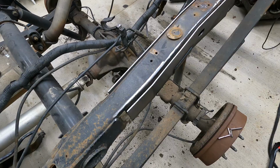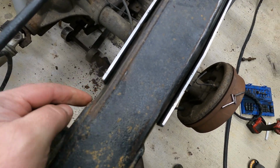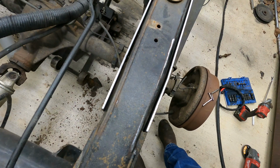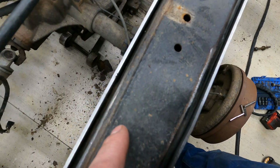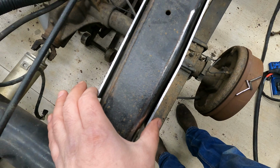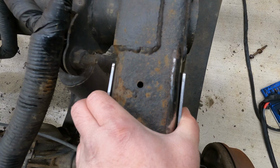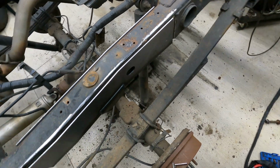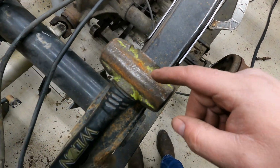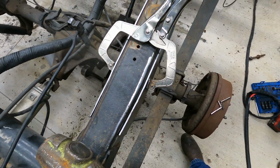Welded in. The frame cap is in place, and as you guys can tell, the fitment isn't as good as the other side. But that is because, as you guys can remember, I welded a plate in last time, about a year and a half ago, and that's why it's got this gap. You can see, maybe, the plate ends about right here. Now I'll end up squeezing this together, all the way down through here. It ain't gonna take much, but it's gonna turn out nice. There we go. Now we got a lot better fitment. Decided to use a hitty wacky poundy thingy and get it all ironed out. It all welded a lot better now.